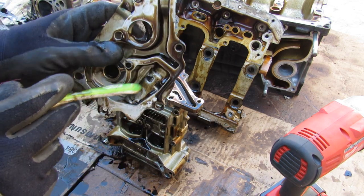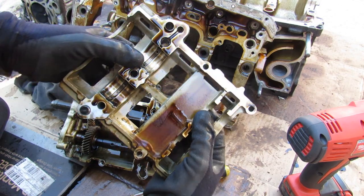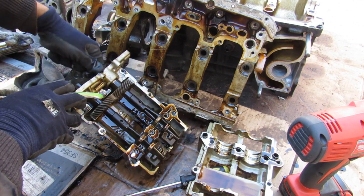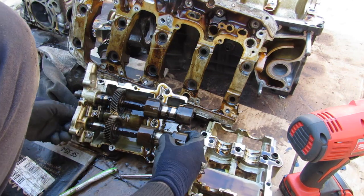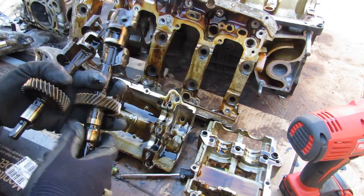This is the oil pressure relief valve. Removing the cover reveals bearing surfaces on the inside, just like your crankshaft. And here we've got the balance shafts — you can see these are the two gears that spin counter to each other, perfectly timed with the engine's crankshaft so they move exactly opposite of the way the pistons are moving. Pulling these shafts out, you can see they're just weights on the end of the shaft.